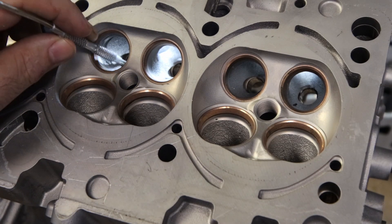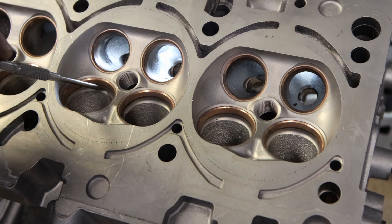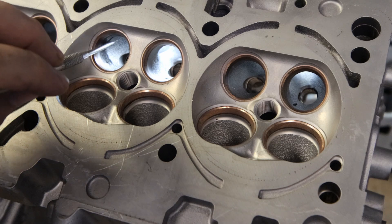To start off, we knocked the valve guides out because you cannot get to all this area here with the valve guide in the cylinder head. So when we knock the guides out, we're just making it so we can have more room to do what we need to do. We're also going to be able to switch materials — the exhaust is actually a steel guide, and we're going to put manganese bronze in it, and then we're going to put the bronze guide on the intake as well. The advantage of going to a bronze guide is we can run a tighter clearance, and it has a natural lubricity, so it has less friction and it's going to take heat away from the valve. It is not imperative, but since we're already removing the valve guide, why would we just put the stock stuff back in?